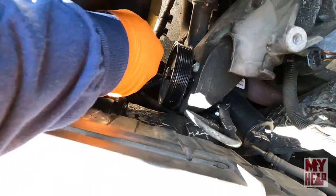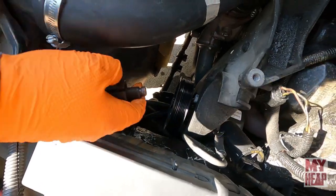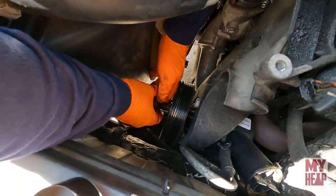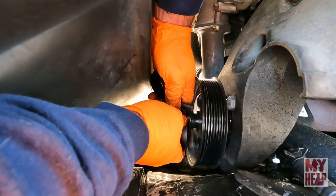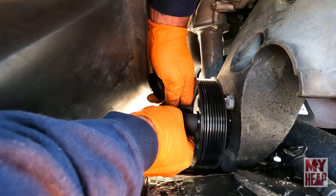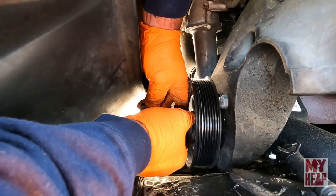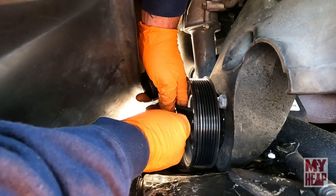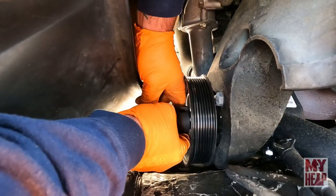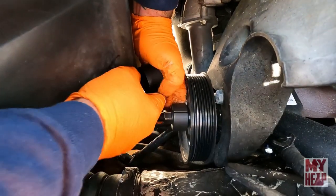Okay. So your hands might be in the way as we record this a little bit, right? Yeah. So maybe after you get it started, I can get in close where they can see what it looks like. All right, so you just put those two little half moon pieces over the notch and adjust the bolt to where it's just touching, and then you slide the sleeve over. Yeah, so these go over the half moons. Run that nut in far enough that you can get that all locked in and together.